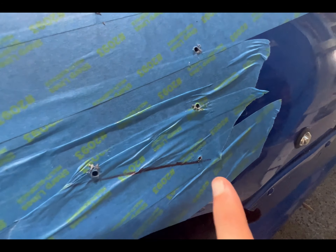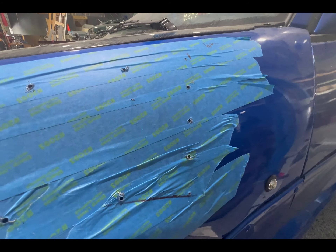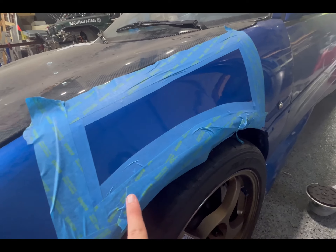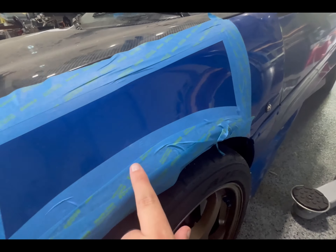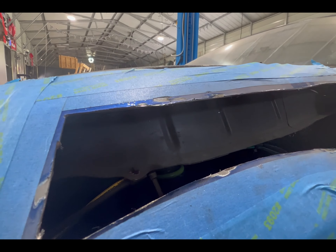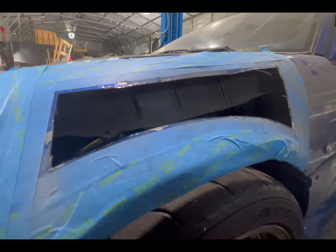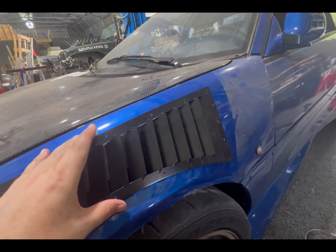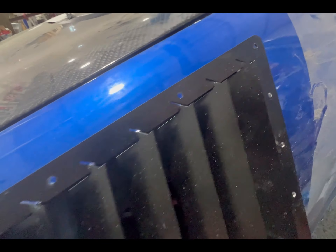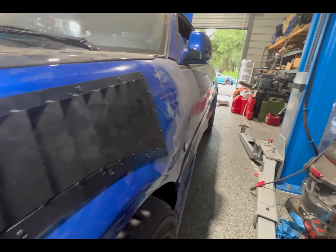Everything's off. I'm just going to quickly drill out the four corners because those were smaller holes just holding the set screws in, so I'll drill those out with the other bit and then take the tape off. You can kind of see the holes. Hole is cut — I'm going to trim the leftover material off until it fits. I got the vent fins bent and I'm just checking clearance. Going to do some more trimming on this side — a little off the top — and it should slide right in. Going to get it riveted on and fix it outside so we can get a better look.